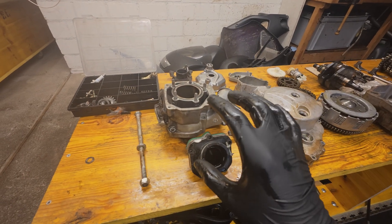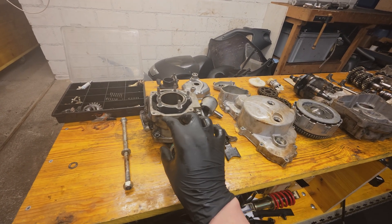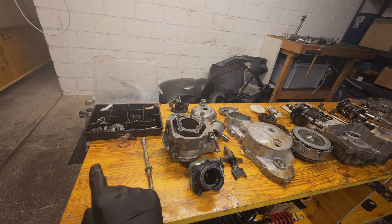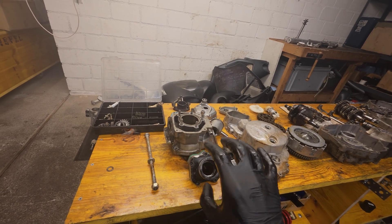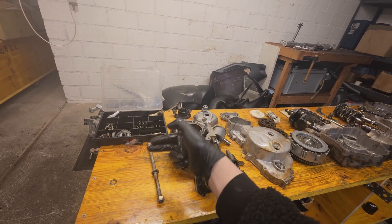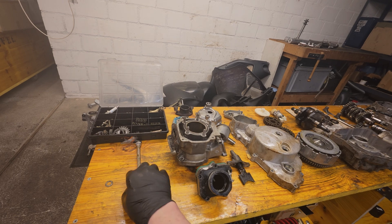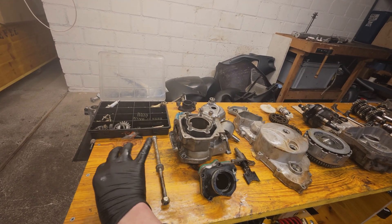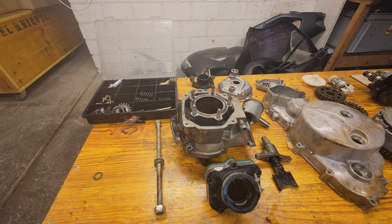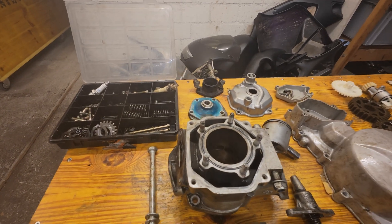There is always an airflow going on, and that's also why we have this specially formed exhaust pipe. It's really clever engineering — when combustion happens, a sound wave travels through the exhaust and gets reflected back. This makes sure that combustible gas that would have been pushed out of the cylinder actually gets pushed back in, making the explosion much better. That's what we call the power band, the resonance. That's just what makes two-strokes really awesome — it's science by itself.